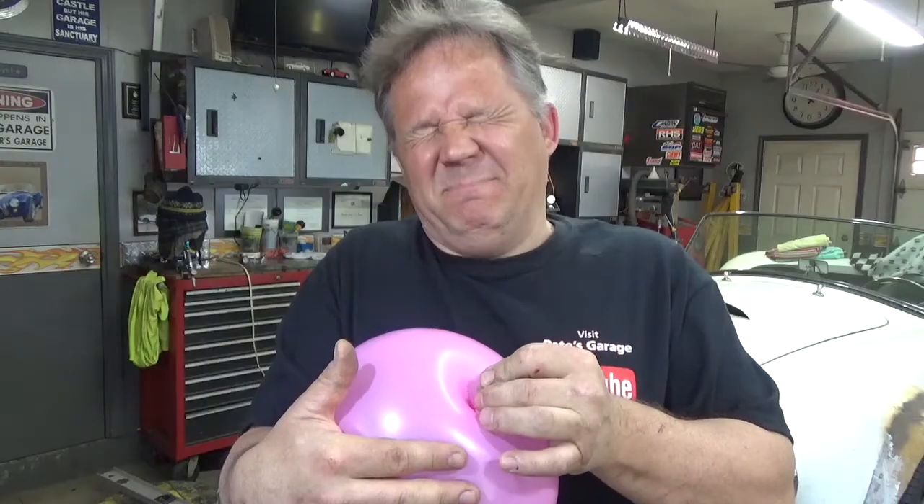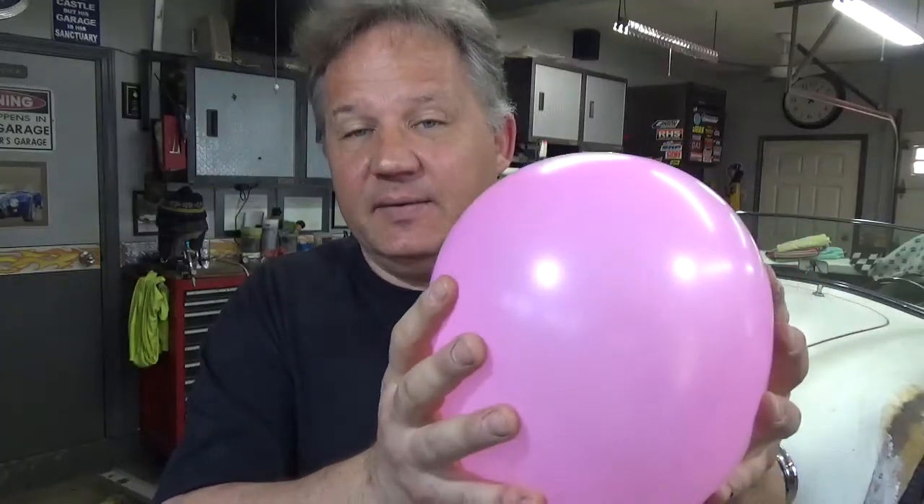You can do it in the end here — this part that's really thick, there's not much pressure there. The pin is inside the balloon without popping it. So now I have a hole here and some holes down in the stem. I originally filled it up to 100 PSI and now it's leaking. If I were to hold pressure in there, I would know how much air I have to replace in order to keep it full. By knowing the leak rate and knowing where it's coming from, we can pinpoint exactly what is wrong with the engine.